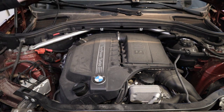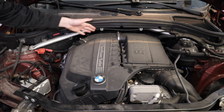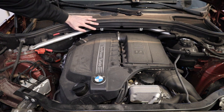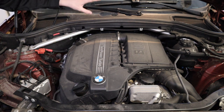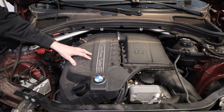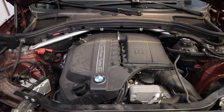Here's the engine — pretty standard stuff underneath the hood. We are going to be removing this plastic piece and this pipe to get at all six spark plugs. What's nice about this is you can get all six up and down. There's not any of them hidden back behind here like on a lot of V8 engines where half the engine's underneath and you can't get at it without taking everything apart. We're going to pull them out, show exactly what they look like, and show that some of these are probably worn out. We also got Bosch spark plugs, and the special socket we've got is a Schwaben part.